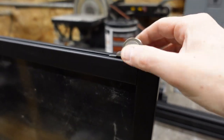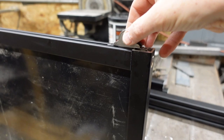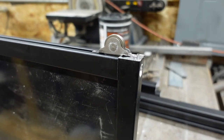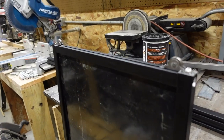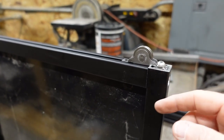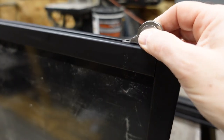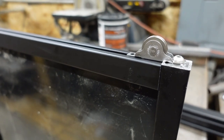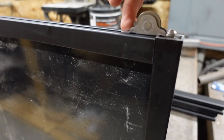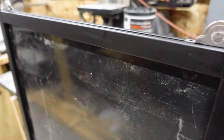Here's the wheel — this is one you'd normally see for a closet mirrored door. It's in the groove; I drilled it out a little bit and then put in the quarter-inch. The wheels are now mounted using a button-head cap screw and a lock washer, which goes into the aluminum only a little bit to avoid the bolt on the other side. Since the wheel is in the groove and the weight just presses down, that should be enough to keep the wheel in place. If not, I'll use a self-tapping screw, being careful not to penetrate all the way through and hit the plastic.